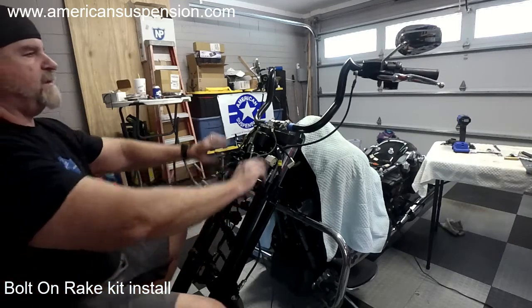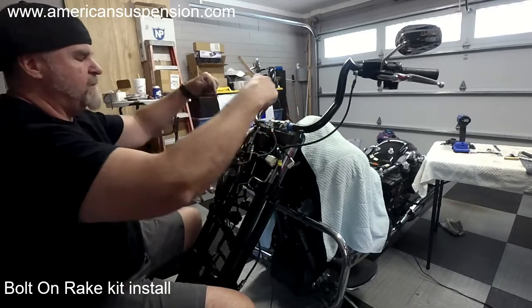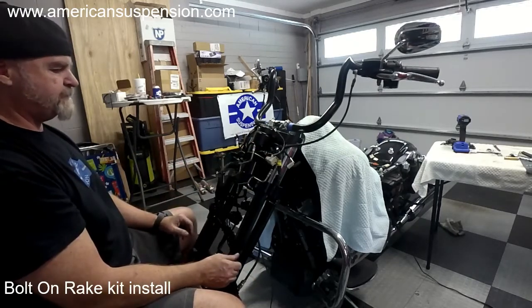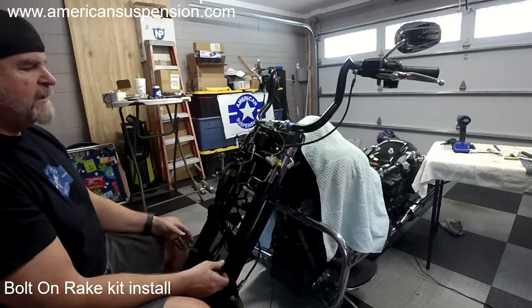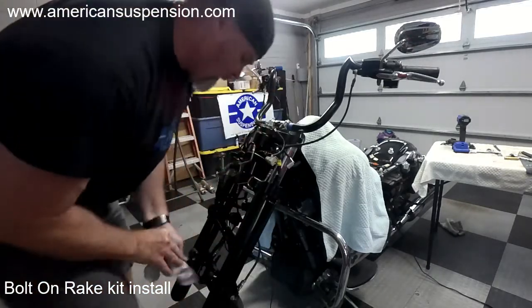So we've torqued down the pinch bolts, the trees, we've got the extensions tightened down, our fitting or our plug in there. I've dealt with the factory brake lines. Really, from this point on, you want to check your swing rate on the wheel, which I'll show you real quick.